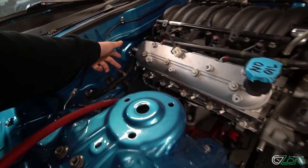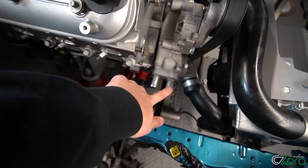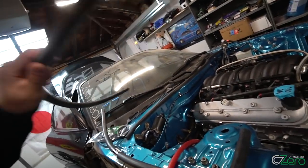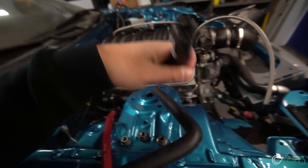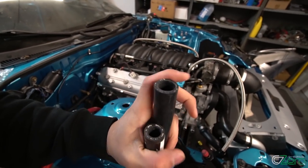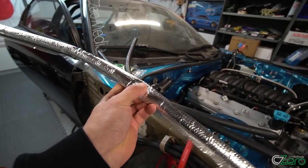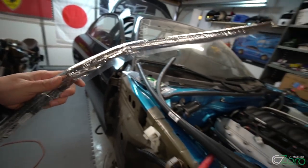One thing I forgot to mention is this piping that goes from the heater core to the LS water pump. You can tell the difference in diameter just by looking at it — the front is larger than the rear, but on the heater core side it's the same size. When I saw that I thought there had to be an L-shaped hose that fits perfectly for this application, and sure enough there are hoses from Gates that fit. These are part numbers 28471 and 18078 — those are the two hoses you're going to need. One side is larger diameter while the other side is the same diameter. Once that's done I'm going to insulate it with heat protector from my guys from wirecare.com.